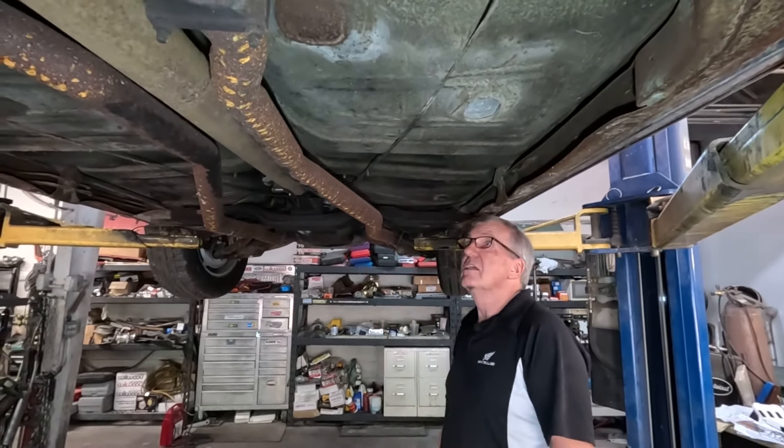Okay, here's the plot twist. The electronic module in the distributor - someone's upgraded it to an electronic distributor and that's failed. Literally no spark. I've pulled a bunch of stuff - pulled the plugs out, they were looking very old, pulled the wires off and they were looking old with the terminals breaking. The old girl's just been sitting unused for quite a while. You've got the tri-power, someone's added an aluminum radiator, upgraded to a booster obviously at the same time as putting discs on the front, and it's got twin electric fans with relays.